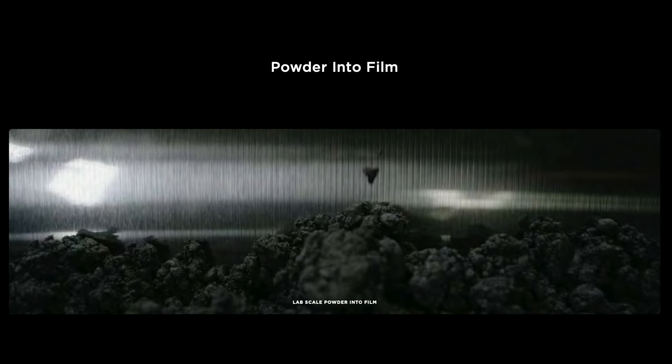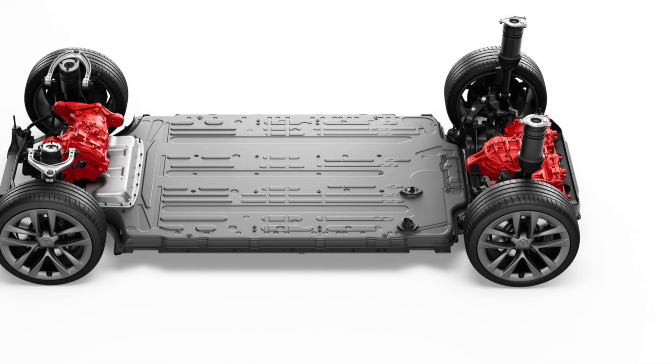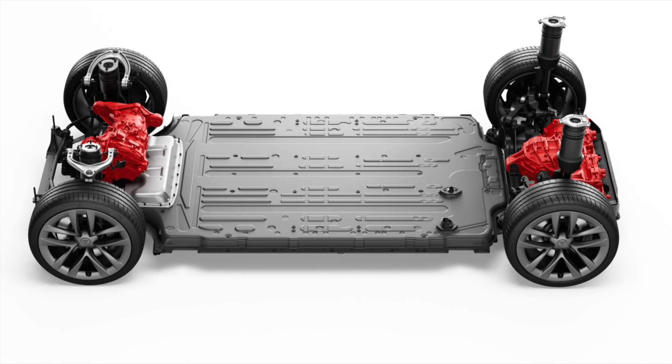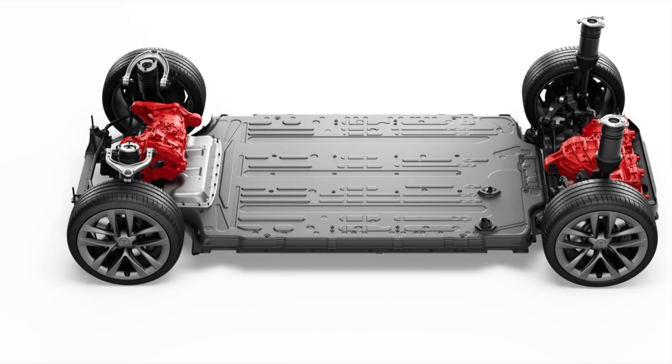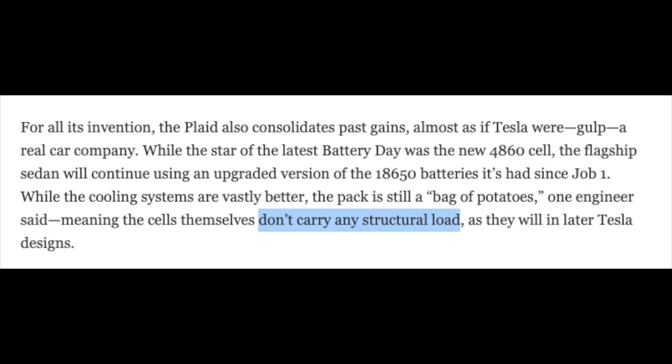But to have gone tabless? Well, that's pretty major, and may not be as easy in the 18650 form. The main advantage of tabless is that it's much faster production speed, but these are not mass produced vehicles, so perhaps that is not quite as important. But if they went the same way as the 4680 line, then Tesla may very well have gone tabless. The fact that Tesla have tabless 18650s could be the reason for the new battery pack — otherwise I'm not sure of the point of the new battery pack, other than if it's structural. But the Tesla engineer in the Wall Street Journal article said the pack was still a bag of potatoes, meaning the cells themselves don't carry any structural load — it is still not a structural battery pack.